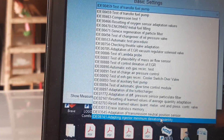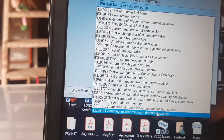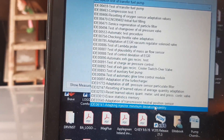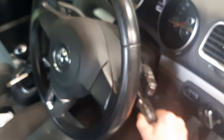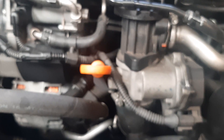The best thing to do is ensure you have adaptation in Security Access enabled again and start from scratch. Go to Controller, close the controller, cycle the ignition completely off, key out, and wait for the ECU to go into sleep mode. At the moment you can hear the throttle PWM signal is still making some noise — wait for that to end.